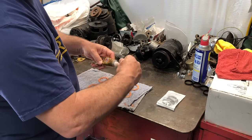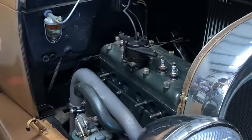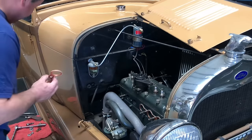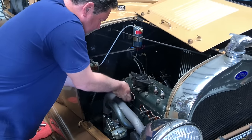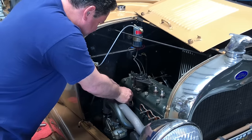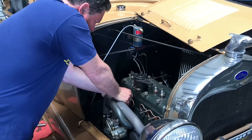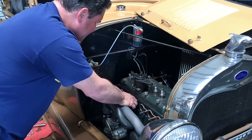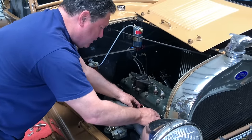Pro tip: if you don't want your stuff to dry out, don't use the little plastic white caps that go over the end. Use these and just don't cut the end off, then it'll never dry out. Goop side towards the block — just stick them on like that. Now this side, unfortunately, this nut is stuck on this stud, so what I'm going to do is just line this up and put this on after the fact, just to get it to line up. I'm going to put this stud in temporarily, then I can just get it to line up and sort of glue itself onto the block. Just leave it sit for a minute, then I'll pull this out. Just leave these sit for a little bit, just kind of skin over — I don't want it to dry, I just want it to skin a little bit.